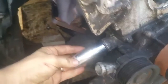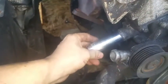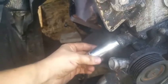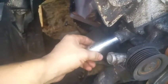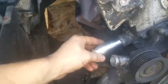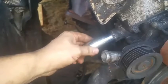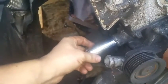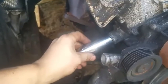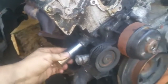Loosen this bolt right here on the side. Of course you need to first remove the turbo, which I just did in one of my last videos, to get some access to it. You could probably do it without removing it, but this is going to be a bolt that's about two inches long, so it helps to have nothing in your way. This takes a number 22 socket — it's a bit loose on there, but a number 21 does not fit.